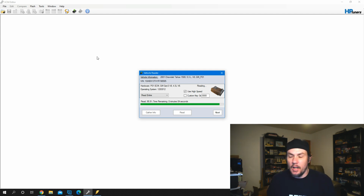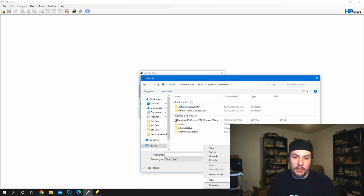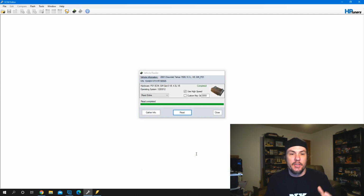Okay, as our read of the ECM finishes up here, it's going to prompt us to save this thing, and this is going to be what we call our as found. So whenever it pops up here, we want to save this as a new file. So I'm going to create a whole new folder for this one. Say this is on a 1999 Camaro or something. And I'm going to come in here and make sure that I list this as my as found. This is going to be the reference file that I go back and look at so I can compare changes, things like that.